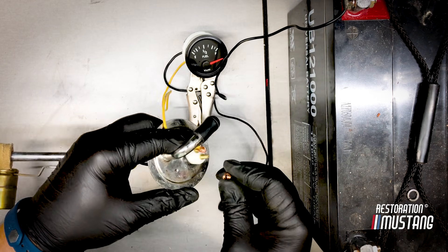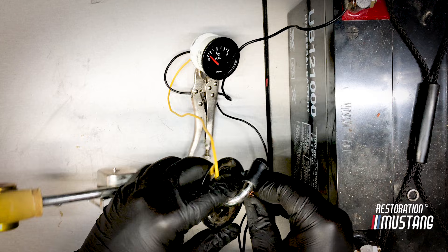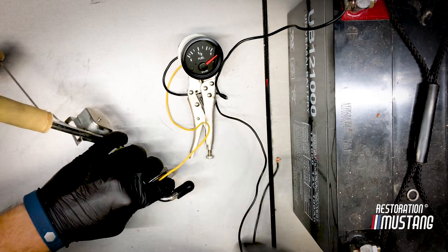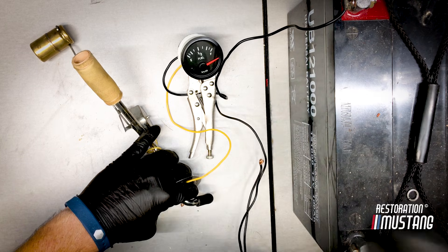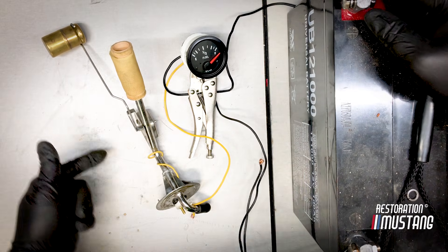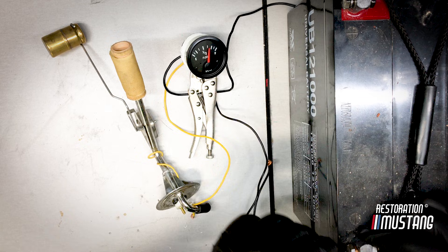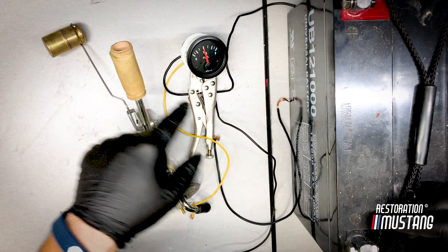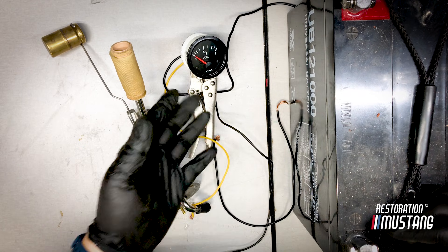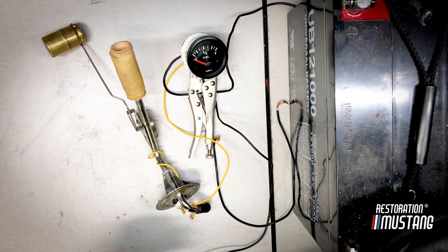You can also have other issues, but this is the fastest way to do it without going crazy. There are videos out there of guys measuring resistance at the different positions of the sending unit, but what I recommend: if you want to save yourself some time, it's probably the wiring whether you've got a new gauge or an old gauge. These things don't fail that often. Sending units are cheap — this one was like $27. Get yourself a gauge, maybe $50, you can get them cheaper from SunPro. Replace your wiring and you'll be good to go, and you won't be stranded on the side of the road. This car actually left me stranded because I thought I had a full tank of gas and I just thought the calibration was off — next thing I knew, I was empty. So it's a quick and dirty way to test: look at your wires, make your analysis, replace the wires.